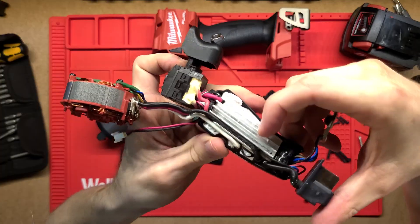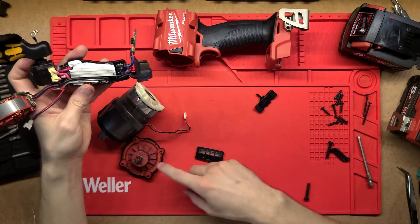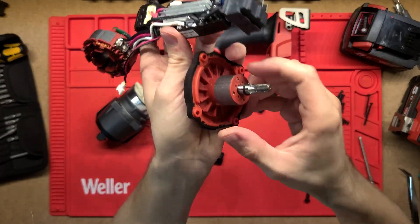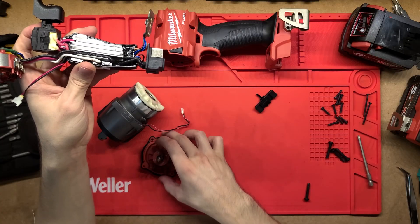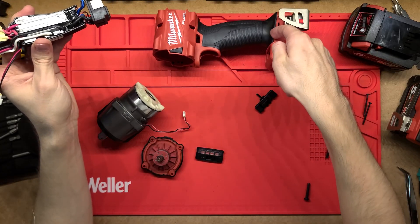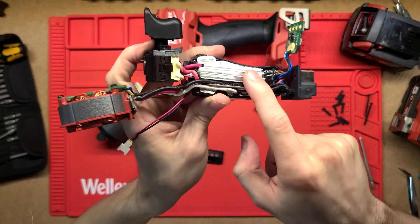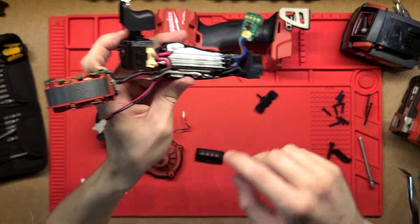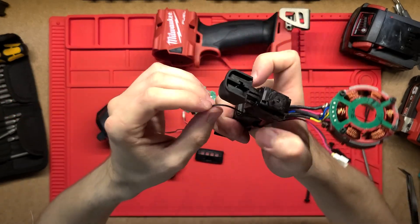It's nice to see we've got this pretty big beefy heatsink here. As this motor turns it's got little fan blades, so those rotate and through centrifugal force push air out — it gets sucked in through the very bottom of the tool, flows up through the handle, through here cooling this whole assembly, then goes through the motor and gets expelled outwards through the back of the tool.